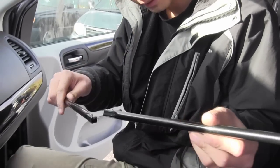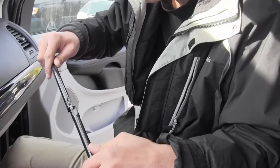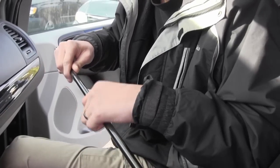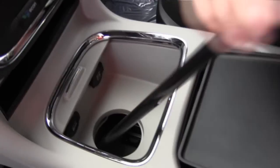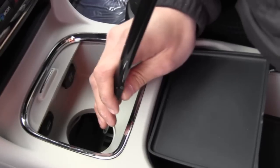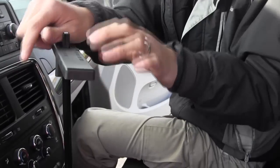What I do is I'm going to take these three items that came in a bag in the back and assemble them together. You can see how everything kind of works together. I'm going to take this and lock it in there. I'm going to take this and put this end down on the top of the bolt — it'll stick up like that. I'm going to take this T-handle, finish it off, and then turn it to the left. This is going to loosen a wire that is holding that tire into place.